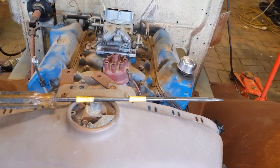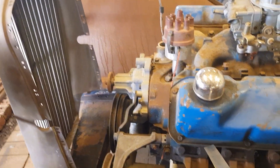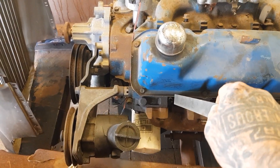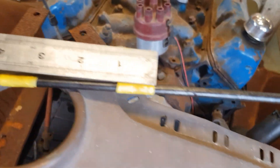Here are our marks — this is how I did it. I put a bit of tape where the screwdriver was touching the rocker cover when the piston was at the top, cranked it over until it went all the way to the bottom, and put another piece of tape there. Now measuring the tape — from the bottom of one piece of tape to the bottom of the other — it's three inches, which means we have a 302.